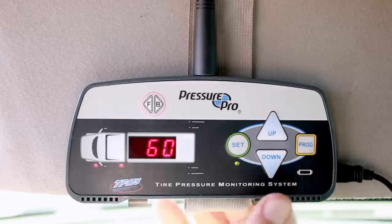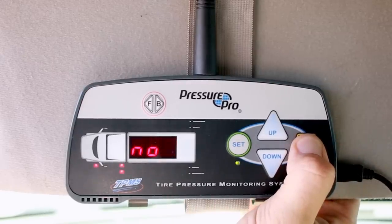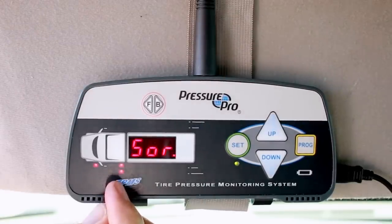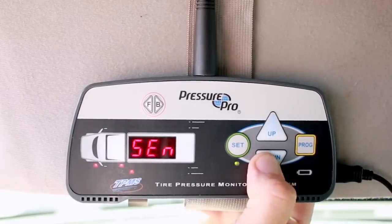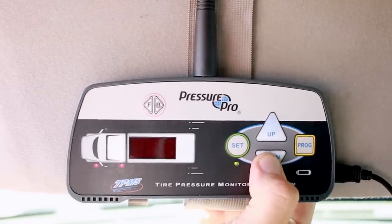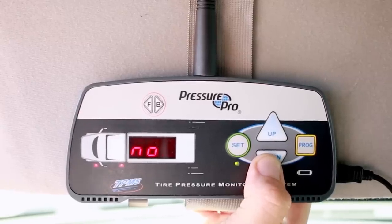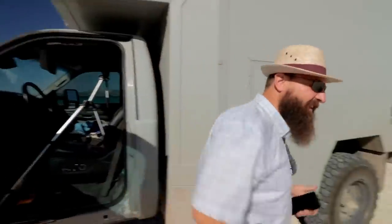Now to lock that unit on that position, press and hold prog for 2 seconds. Now you can see here, this dually outside wheel is flashing. We don't have this. So then we just go to the next, next, next. Holy Dino, there's a lot of tires on this rig. And all the way back now. Okay, so now passenger side rear, it's expecting a tire. Let's run over there.